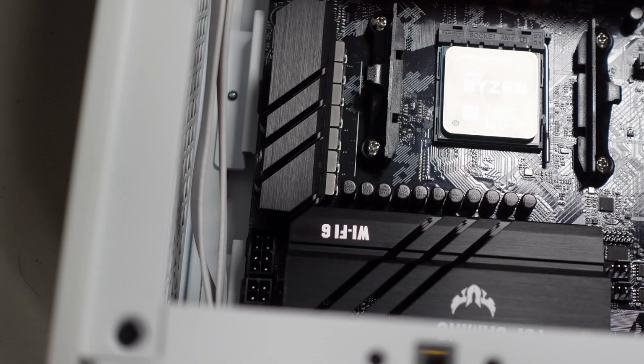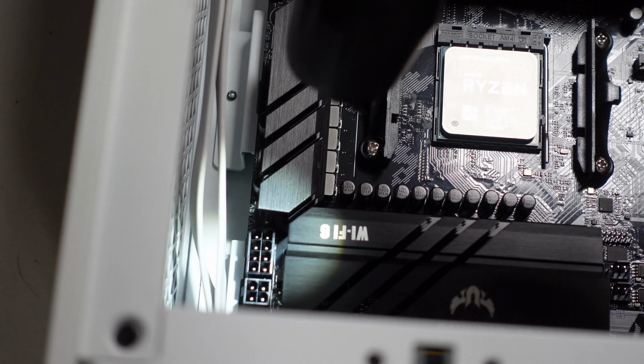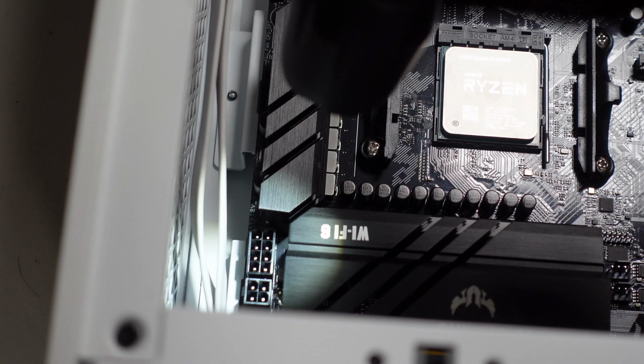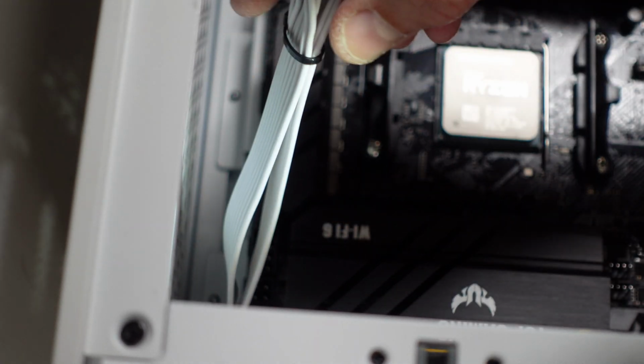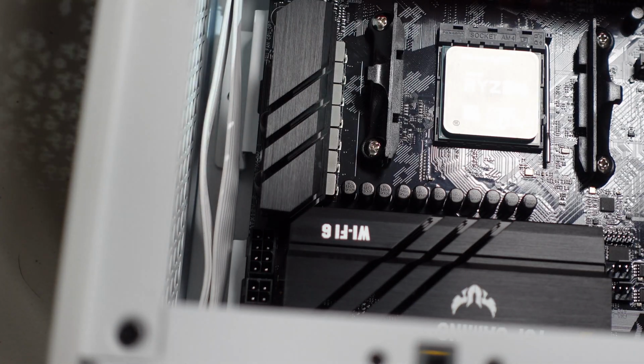And we're done. Now I'd like to start doing the power cables, but I start with the hardest one first, which is not that bad in this case, the 12 volts for the CPU. We have 2 cables we got to put in there, one an entire one and one only half of it. So let me prepare those cables to start with.